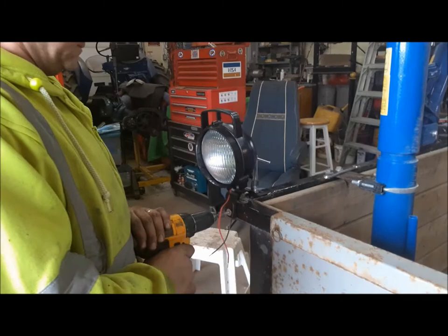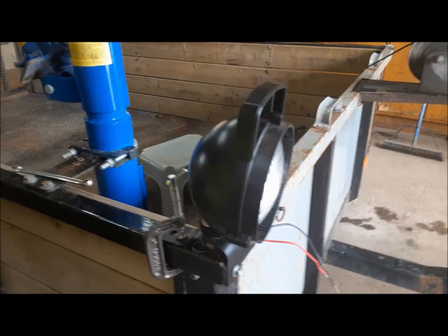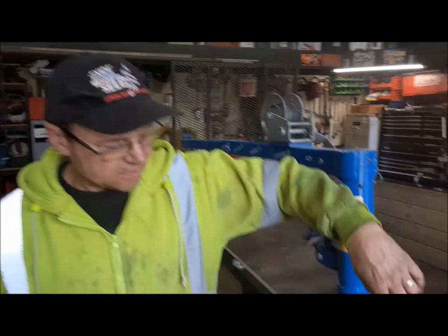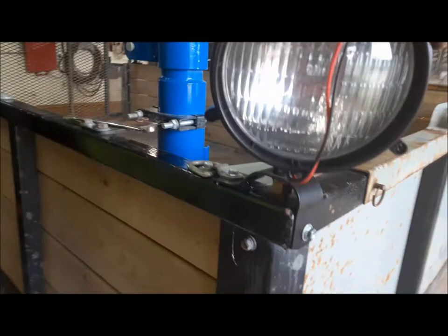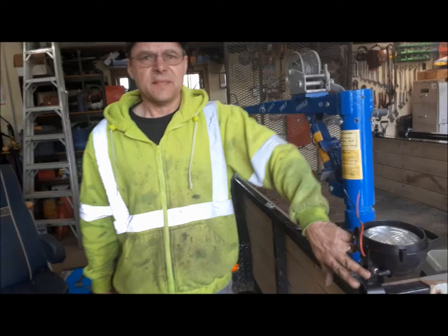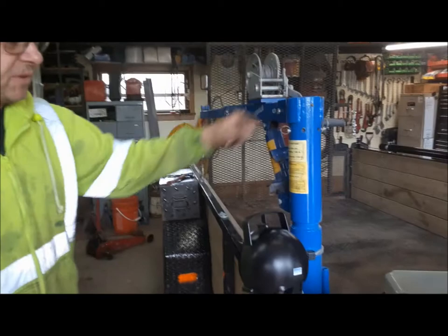With the light positioned, I'm going to zing it in with a self-drilling screw, then put another one in back here that will also pick up our tie-down — because we don't want to lose our tie-down. Our light's on and it swivels around nice, but I would like to get it to aim down a little bit more. It won't, because this here hits inside the bracket. So we're going to fix that. I filed a little notch in the bottom of it, and now it aims down sufficiently that we can light up the floor of the trailer and an object on the ground that we might be picking up with the crane.